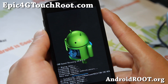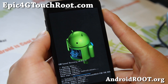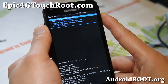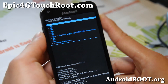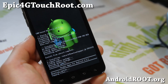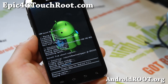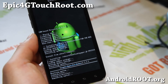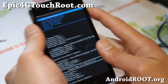We're gonna install Google Apps — that gives you the Play Store and everything you need. Choose it from SD card, go to download, go to the gapps zip file. This is the gapps — you should have downloaded it and copied it over as one of the three files. Google Apps 4.2.1. Once that's done — it should take another second or two — we're gonna reboot. And you should be in full Android 4.2.1 mode on CM10.1. Go back and review the system now.